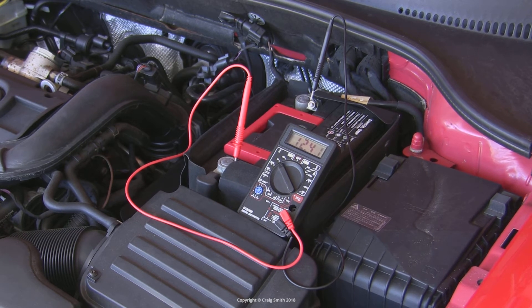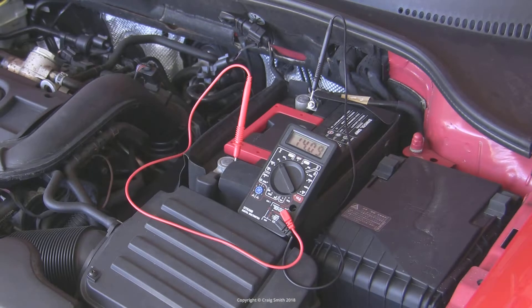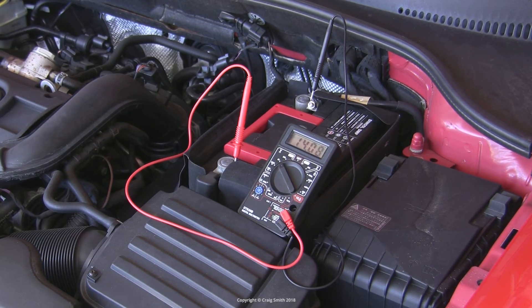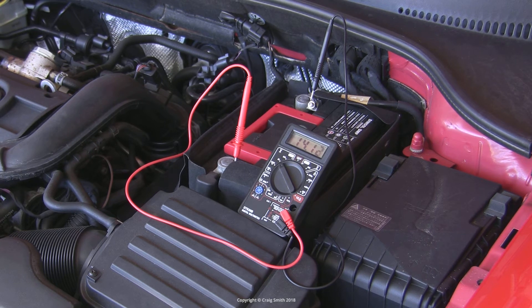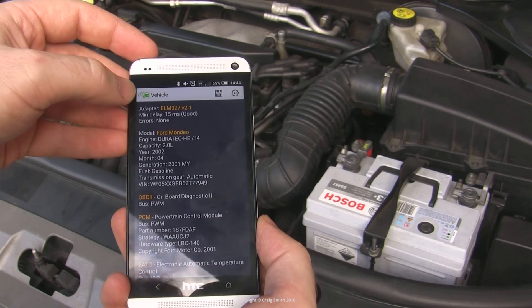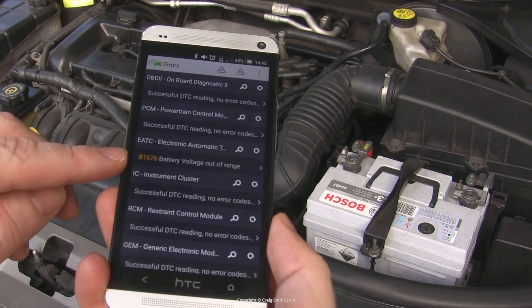The best option is if you have a multimeter with a min/max function. Hook it up to the battery and record the voltage during an engine start, then look at the minimum voltage captured. This multimeter shown here doesn't have that function and its measurement rate isn't fast enough to be useful, so the lowest reading shown here isn't accurate. But if you had one, you'd look for a minimum voltage during engine crank of 9.6 volts. Above that, the battery can provide the cold cranking amps required by the starter motor — the crucial test for any car battery. Below that, you're looking at trouble. In fact, if voltage dips below this, you might end up with error codes set in the car's ECU by various modules complaining of under-voltage conditions.